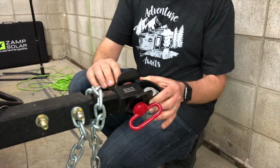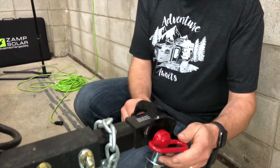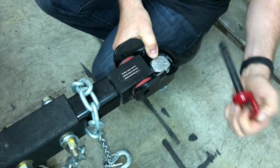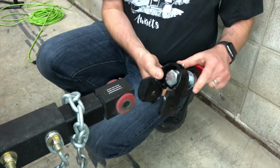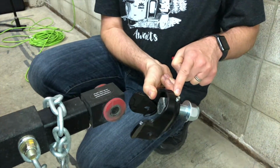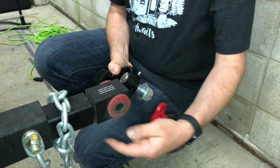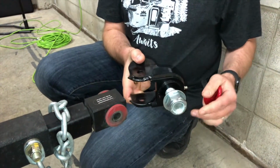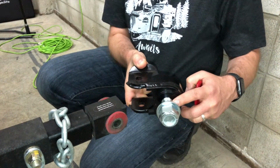If you have a max coupler option like we have here, in order to lock or unlock it from the vehicle, just pull the safety pin, pull out the hitch pin, and then your coupler will disconnect or reconnect. Maintenance for the max coupler is two Zerk fittings for grease, both on the yoke that will be attached to your vehicle and on the bottom of the max coupler. When you receive your trailer, the coupler will be inside the cabin of your trailer. You just need to install it onto an appropriate ball mount for the proper rise or drop on your vehicle.